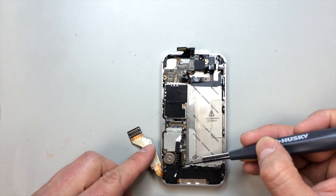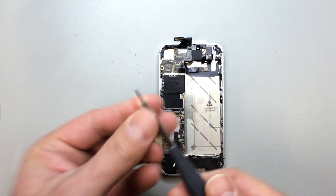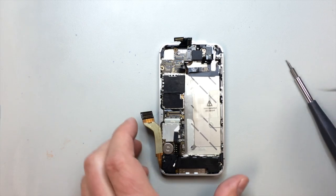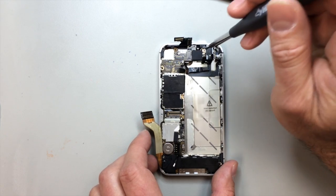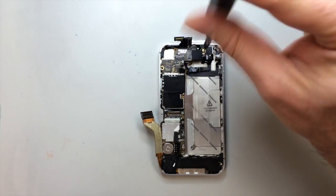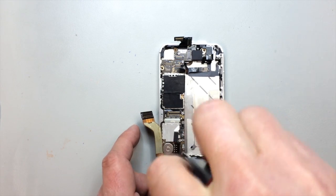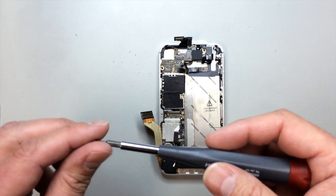And now we've got these threaded barrel screws that are kind of goofy. They're not really a Phillips and they're not a standard, but usually if you take a slotted driver, you can get inside there enough to turn it, and then a lot of times you'll transition over to a small Phillips, which you can see is probably just going to spin around here at this point. So the slotted one you'll need to use to break the screw away when it's tightened down all the way. And when you're putting it back in, you'll use it at the last step to make your final turns. But initially, threading those screws in is best done with a small Phillips magnetizable driver.